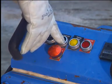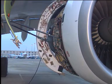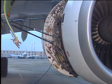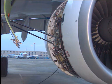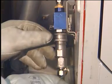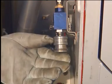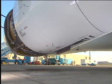Open the pressure relief valve on the pump to close the thrust reverser half. Disconnect the pump from the manifold. Repeat this closure operation for the opposite thrust reverser cowl.